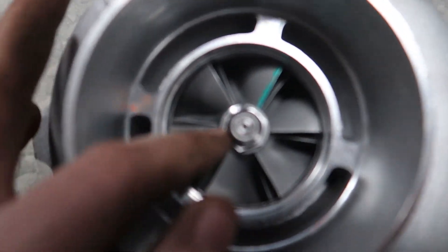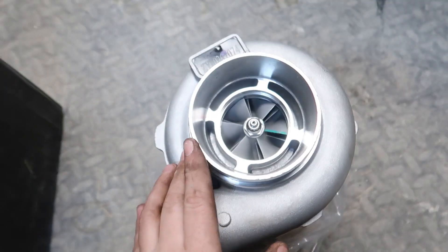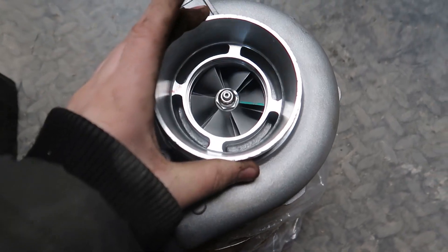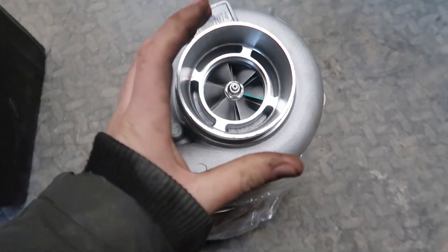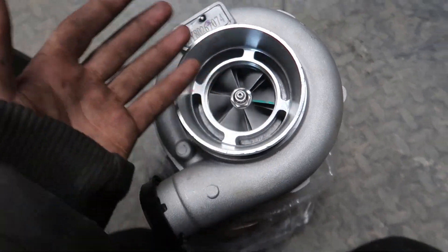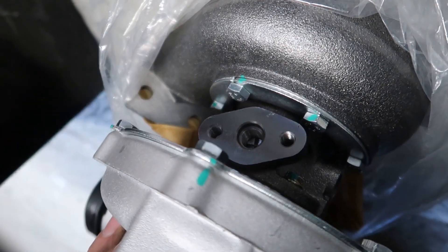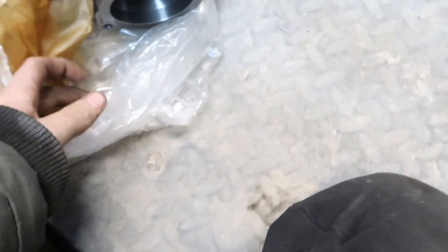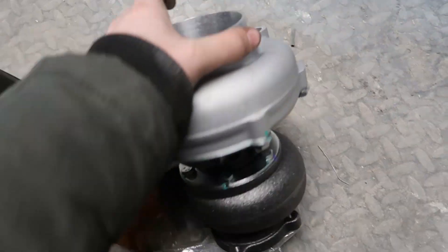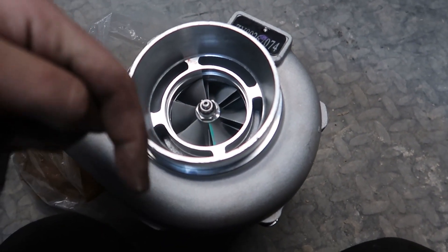Beautiful mate, it's all lovely and balanced as well. They make sure every turbo is nicely balanced — you can see the ground-down nut there. This one is a GT30-37. It's got a four-inch inlet so you can put a nice big pipe on there for all the dose noises. It's got the anti-surge system so that you don't get too much surge. This one is water cooled and you've also got your oil fittings as well. This particular model comes with a four-bolt rear and a T3 manifold fitting. I can't remember the exact details of the sizes of the turbines but I'll put it on screen or you can click the link below to check it out.